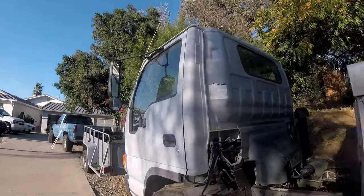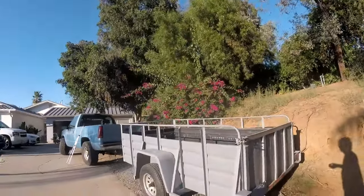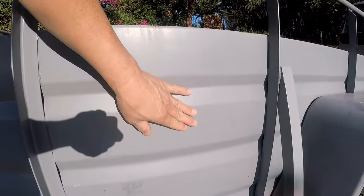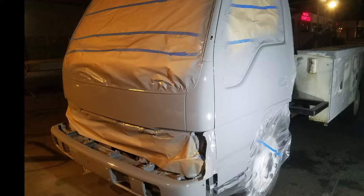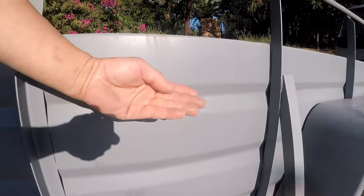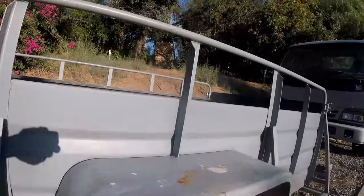The truck and trailer have always been kept outside in the sun, so they both have the same exposure — I think it's a pretty fair comparison. If we look at the trailer, the paint has dulled some. I don't have pictures of when I painted it, but after I painted it, it was pretty smooth, though not as nice as an automotive paint job. Now it's just dull and slightly chalky, but not a whole lot. I wouldn't say this is paint failure — it's kind of expected of oil-based paint.